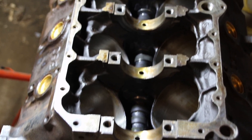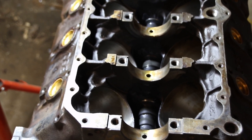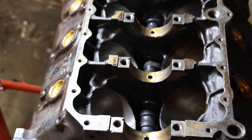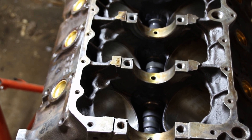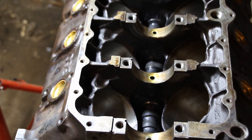I'm going to pull it out again and go back and polish it. I'm about 5 to 6 tenths off of the bearing surfaces. It goes all the way in now, but it's still very, very tight. That won't be able to run that engine very long. So let's take it back, polish it again, and see where we get the next time.